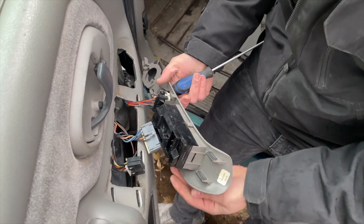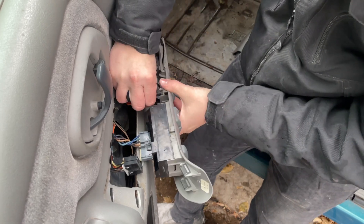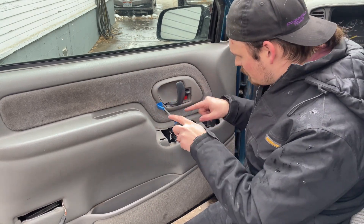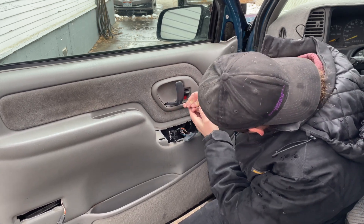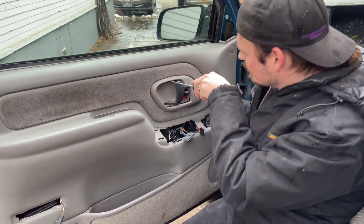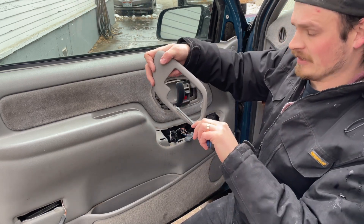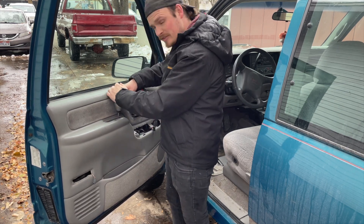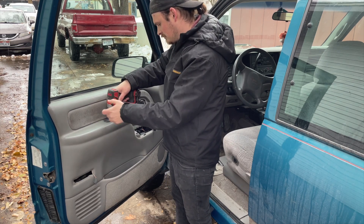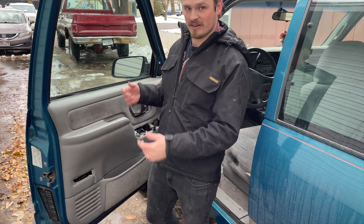There's normally a tab on this one, but looks like somebody broke it off — probably me — so we'll just pull that one off. And that's it. Last piece to take off is this bezel. There are three clips in it: one down here, one here, and one here. Push in and down to pop the first one, in and down to release the second one, in and up on the third one, and off comes the bezel. Last two things are these two screws right here. Like I said in the Malibu video, anywhere you pull on a door there's usually a screw. Now that everything is off and out of the way, we can go around the perimeter of the door and start popping all the clips and the panel will come off.